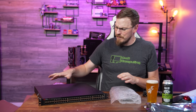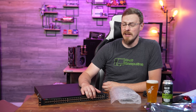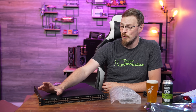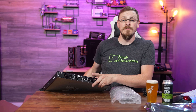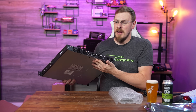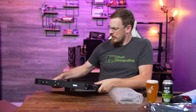First and foremost, there are the 48 RJ45 gigabit ports on the front, as well as 8 SFP Plus 10-gigabit capable ports over on the left-hand side. Around the back is where things get interesting — there's a couple of management ports, as well as four 40-gigabit capable QSFP Plus ports, and this is the whole reason I bought this switch. Of course, there are the other enterprise networking accoutrements such as dual power supplies and hot-swappable fan ports.